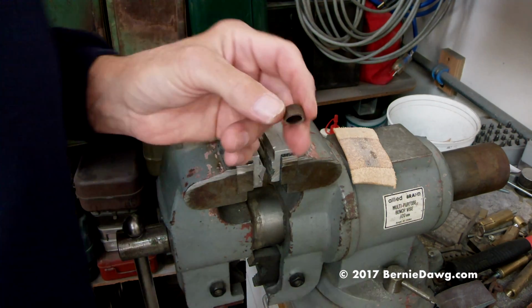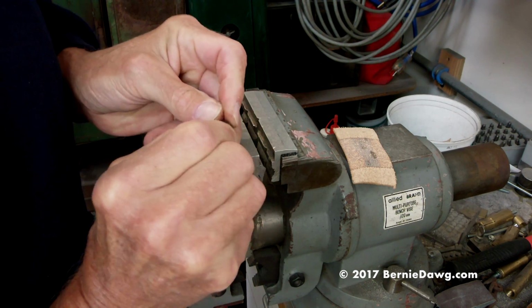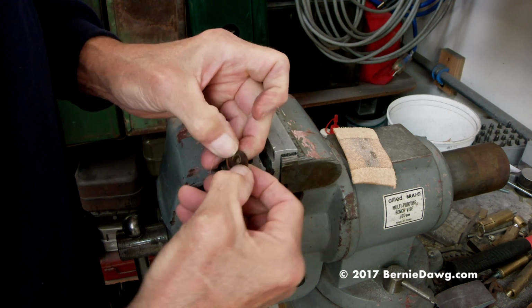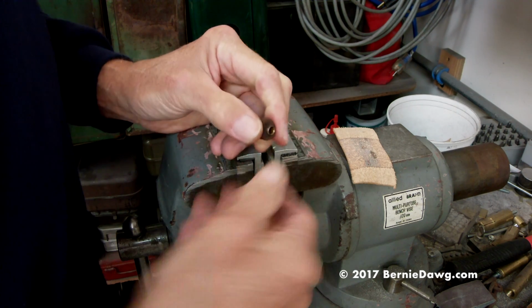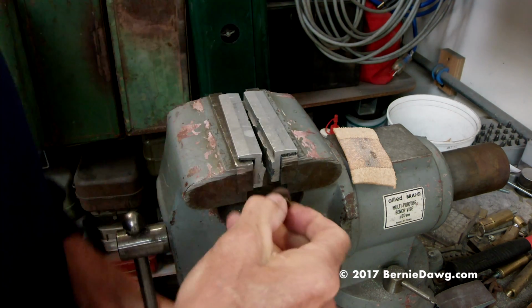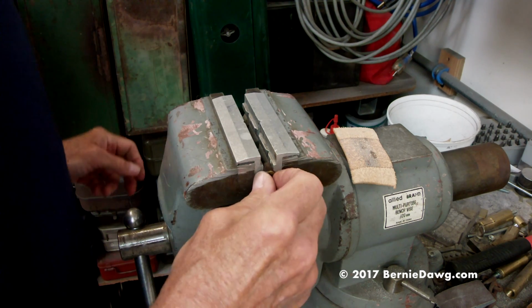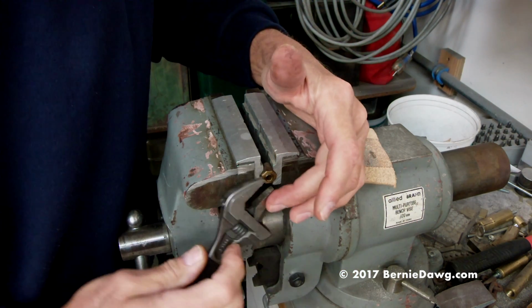Okay, so here we are back here. And so now I just go ahead there. Again, work it down so that the leather is past the threads, so the nut will have somewhere to grip. You have to have some threads so the nut can thread itself on there. And we just work those down like that. Get that started. And then again, you can just use your vise jaws, your accessory vise jaws, without hurting anything, because see, they're aluminum, so they're soft. And get the rest of that on there. Again, adjustable crescent wrench or an open end wrench of the proper size will take care of that.